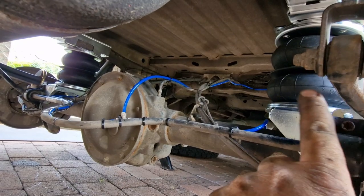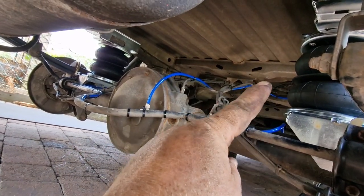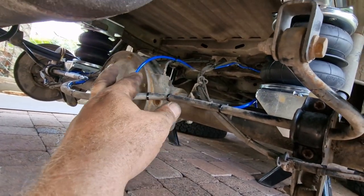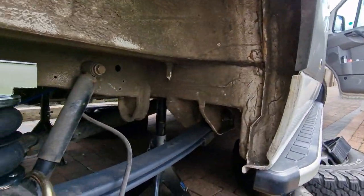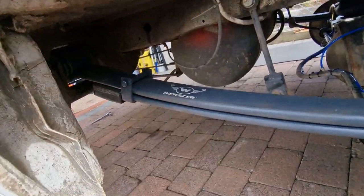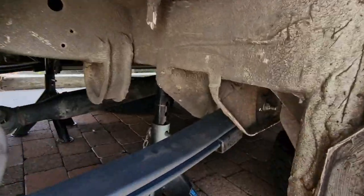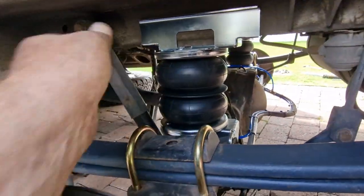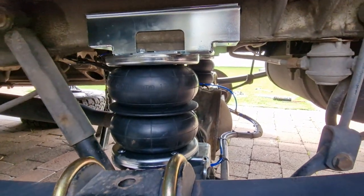Look what we've done — we've got airbags. There's a two-piece line that runs back to the controller and where you fill it — that's up at the front of the van. Nick and Jen have chosen to put theirs up in the cab rather than the rear like mine. It's all fitted. The writing goes to the back on this one — we measured that against the beam. Everything's fitted, tidy, job done. They're definitely inflated. We'll get it up to two bar and then spray each of the joints with some leak detector, make sure we've got no little leaks.